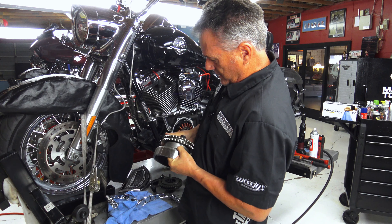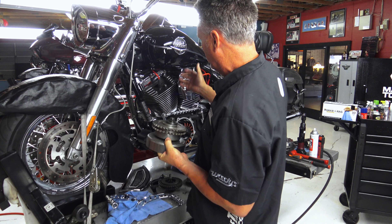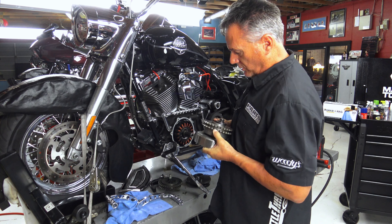Main shaft — the bearing on the other side is starting to deteriorate. I noticed when I drained the transmission oil you can see some of that metal swirl in there. Maybe the nut just started to back off, and that's what caused the bearing to start to wear. But anyway, this should have zero end play. You would have sworn it was the front screw on the compensating sprocket that had backed off, but it hadn't.